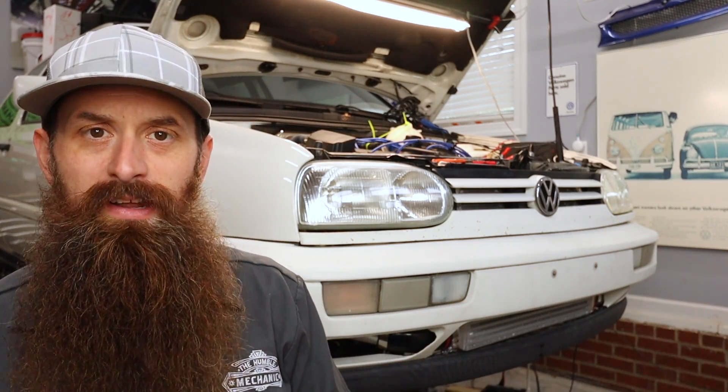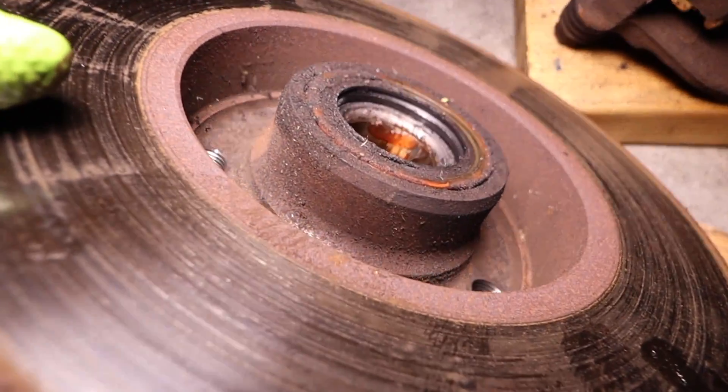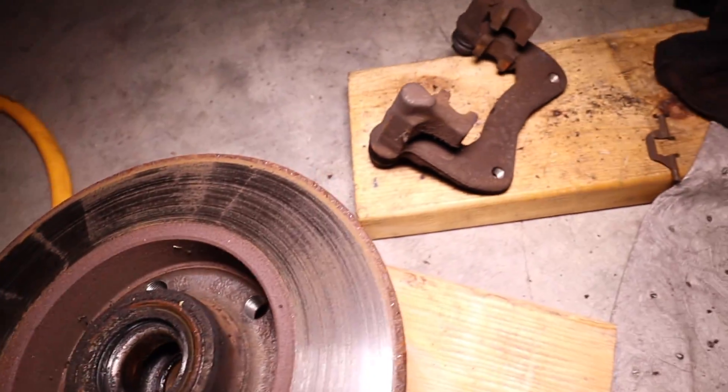Since I haven't done anything with the rear brakes, the car had to have come that way. This made me go back and wonder — were we having these brake issues the whole time and I just never knew? Did I never have communication with the ABS module? Did I never have wheel speed from those back two wheels? The answer is clearly yes. Why wasn't the ABS light on? Maybe the bulbs burned out — this car's old, it actually had a bulb. This definitely just solidifies that this car was not well-loved over its life. So at this point we have a handful of options — we can get rings, put them on the rotors, put the brakes back together.